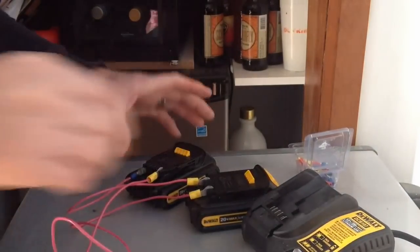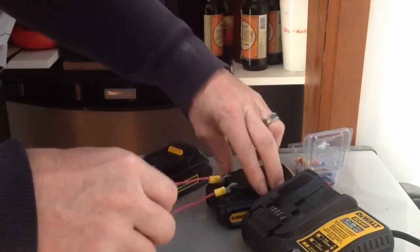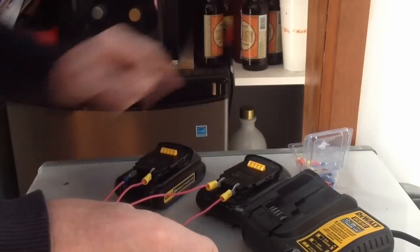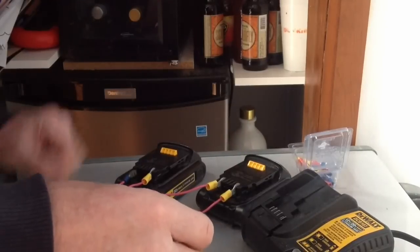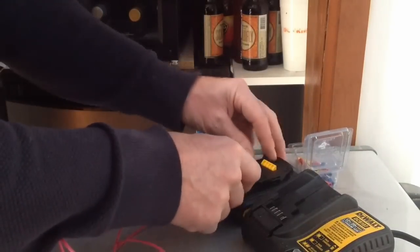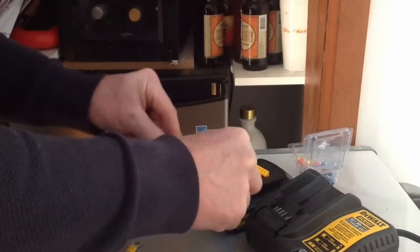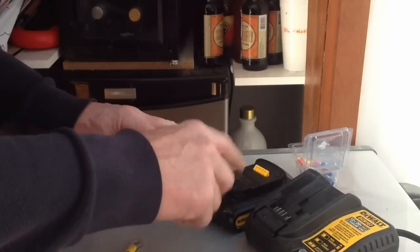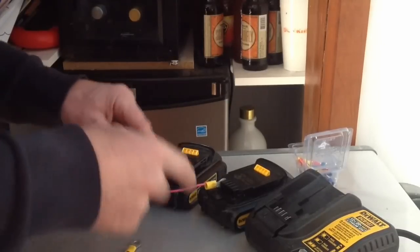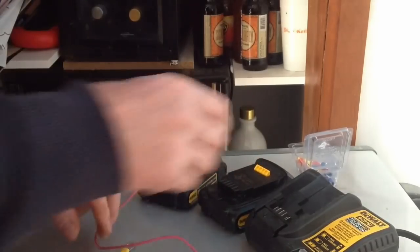That was really no more than two minutes. I want to mention again — because it's not obvious since I'm using two red wires — positive to positive, negative to negative. There's some questioning about that on the internet, but that is what you do. Also, it's smart to take the negative terminal off of each battery when you're done. Otherwise, if you leave positive and negative connected on the good battery and the ends somehow touch each other, you could do damage to the battery.